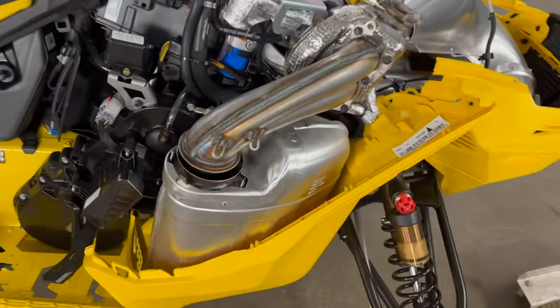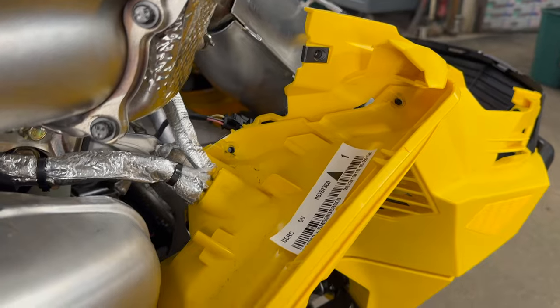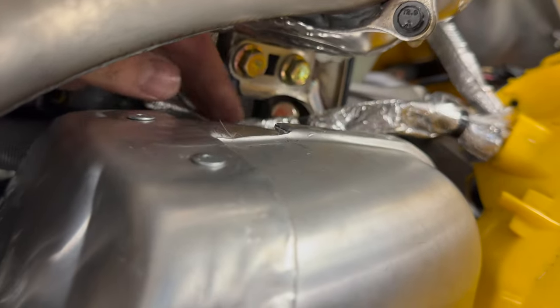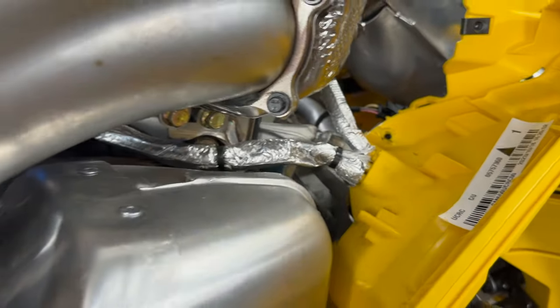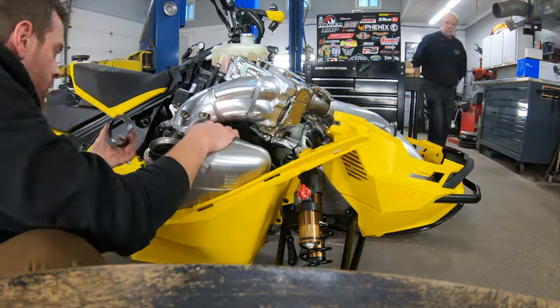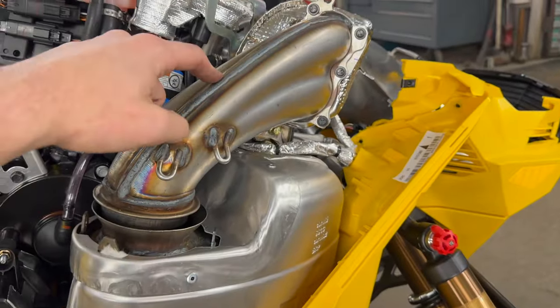All right, I tried a bunch of different things. I got the rivet out of the bottom here. I loosened the top two. I pulled the lower bolt out that houses this little grommet. It's a long through bolt that keeps this from coming up off of the cross brace here. I don't see how you're gonna get this muffler out on a trail one with this side panel still on. The easiest route's gonna be to just pop this downpipe off.